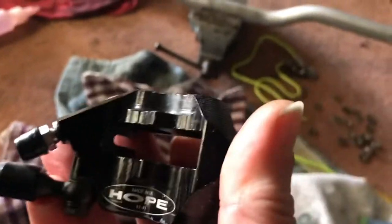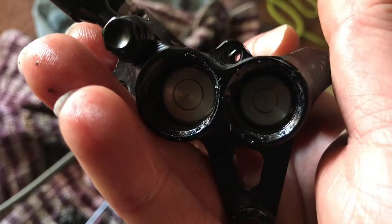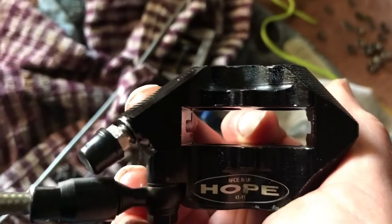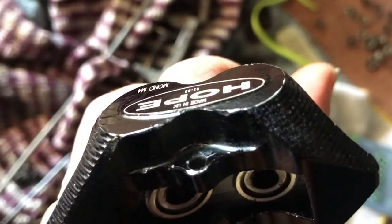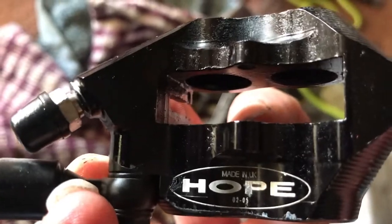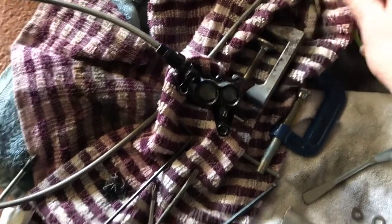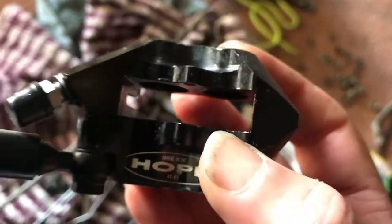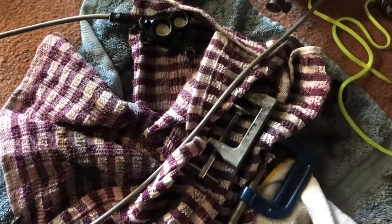The point I wanted to make was about the pistons - where you can remove the caps on this side, dead easy to remove and dead easy to push out. The problem is those are the ones you don't want to do first. Obviously you need to do these ones on this side first, because as you can see there's no cover, so you need to pump them out with whatever fluid is left in the reservoir. You'll have to re-bleed your brakes if you get it wrong, because one piston could pop out on one side - hence mine nearly did, and I popped it back in using a tire lever.